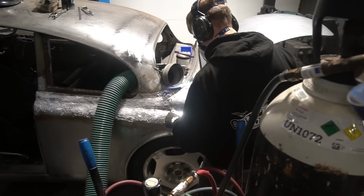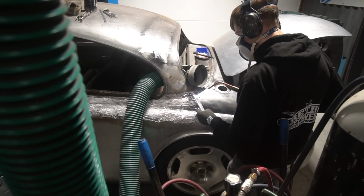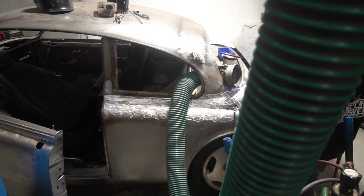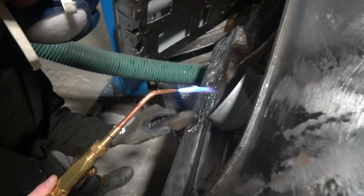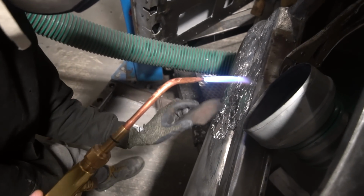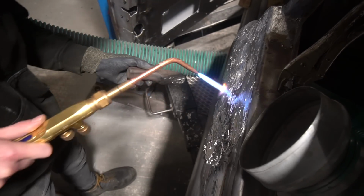But yeah, Stu's working on the rear sort of 3/4, bottom of the C-pillar, fuel filler, which is on the haunch of the car there, and also getting the line down the quarter panel fine-tuned, ready for where the chrome trim's going to go along there. Again, that's getting that line exactly right because of the various panels that have been grafted in. There's some slight deviations in that body line, so it's just adjusting that line using the lead to get that exactly right. So that's what's going on there at the moment.